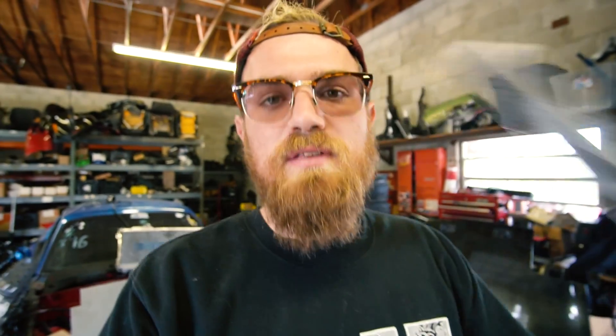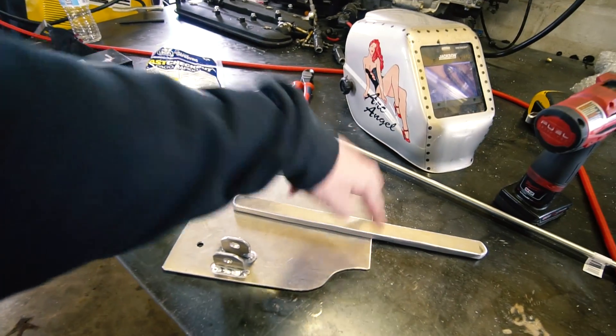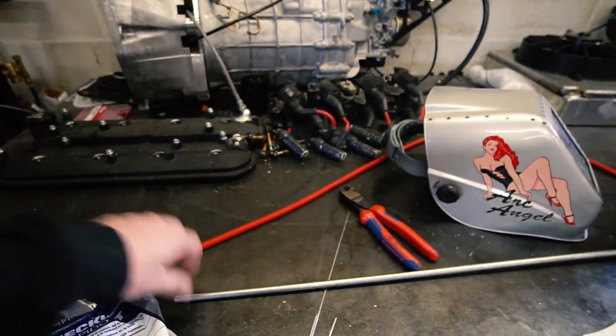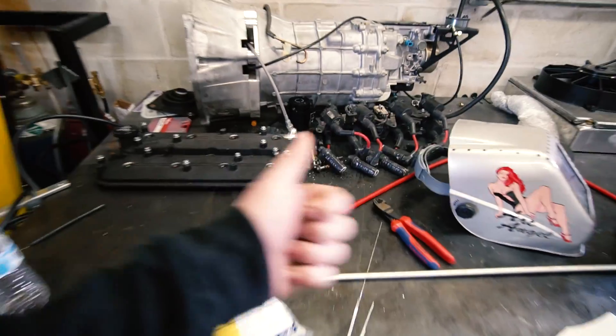Handbrake build day two — we do not have time to slack today. We've got to get straight to work, have a plan, and run with it. First off, drilling a bunch of holes. Luckily it's aluminum — very easy to drill and cut. If I had to drill eight holes through steel it would take me an hour; with aluminum it'll take five to ten minutes. We need to drill about two holes up here and two holes down here to riv-nut those in, and then I've got all my hardware to mount the handle and make the clevis. This is going to be our rod going back. Let's get to it.